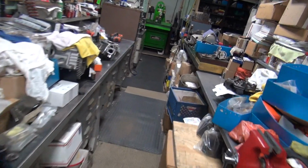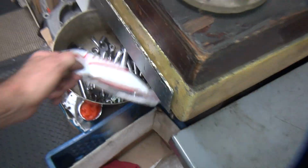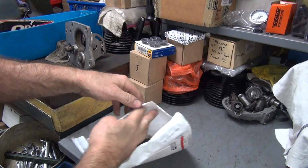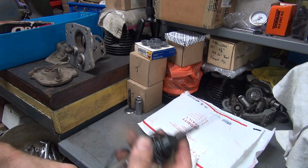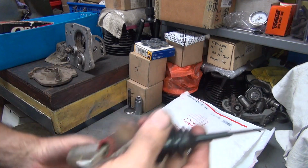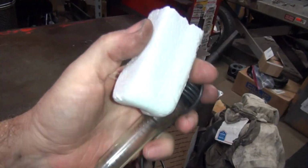Sitting too much. Okay, so if you guys don't know what a test light is, this is a test light. What's in the bag? I was working on my car. My oil wasn't working. You hook it up to power, you hit this other end, and the light bulb comes on if the power goes through it. Doesn't matter if you're going negative or positive. It works either way. And this keeps you from poking yourself.